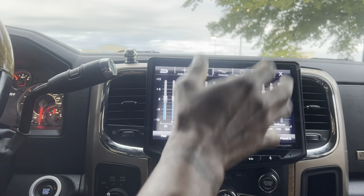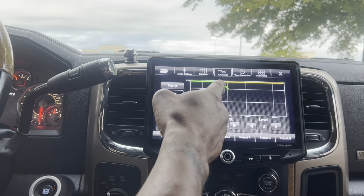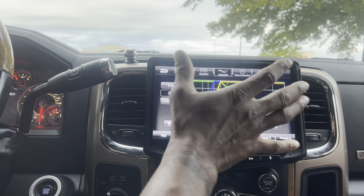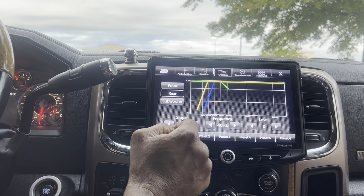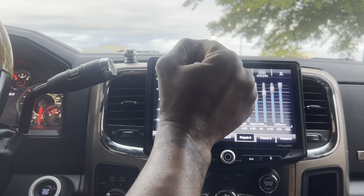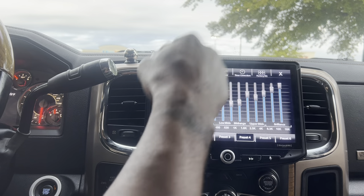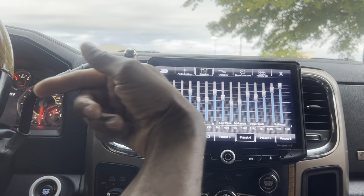Now remember, as I said before — your crossover settings depend on your speakers and how low they can go. Most people on their subwoofer use 80 hertz and under. Some, depending on the music they listen to, use 150, 160, or even 250. This is opinion — it's not set in stone. You can cross over your sub however you want. I'm a bass purist — I like it at 80. Never let anyone tell you your EQ should be here or there — that's the music they listen to, and that's their opinion. Also, their vehicle may sound different from yours. That's why it's called equalization — to equal out the sound — and where you increase or decrease is based on how you want it to sound, not how anyone in the comments wants it to sound.